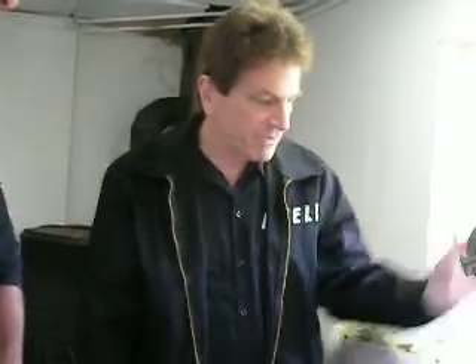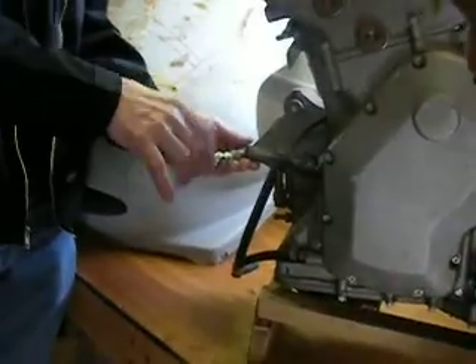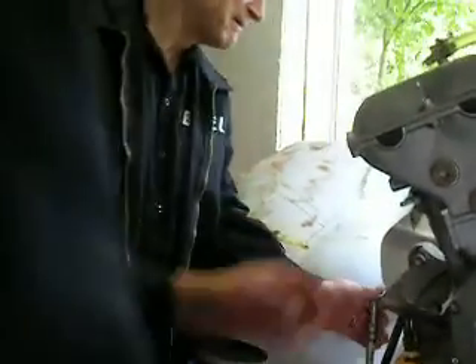That mount is actually a tie bar to go to a V-bracket to make the engine a stress member of the frame, so you could get torsional rigidity out of the chassis. This was rubber-mounted because it had no balancers in it — 60 degrees. So we needed to let it vibrate. And that's where the starter would have been. It's pretty narrow.